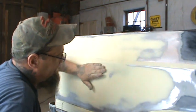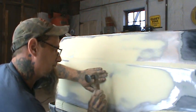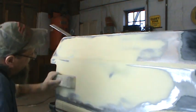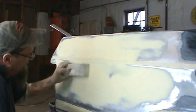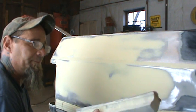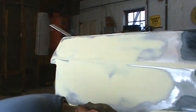This area is giving me a hard time, but it feels good all the way around. You can go as far as like this, or even more like this, or whatever makes you feel comfortable. It depends on the size of the Bondo area you're working with too. If it's bigger than this — I mean I got pretty well the biggest one you could buy and it's probably maybe double this.